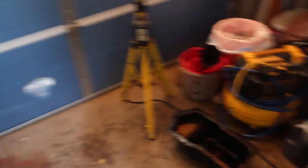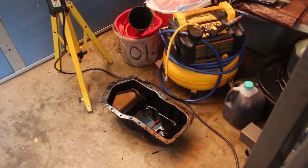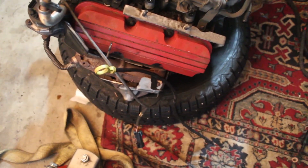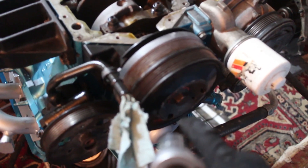Once I have that done, I'll put the new oil pickup tube on. I don't think I have time today, but we do need to clean out the old oil pan — the Camaro's oil pan — to put on it. One thing I did forget to mention: I did get the dipstick removed from the oil pan as well, so that should be good to transfer to the new motor. Alright guys, I'm going to go ahead and torque the main crank bolt down — it is 111 foot-pounds plus 76 degrees.